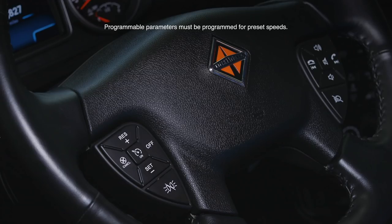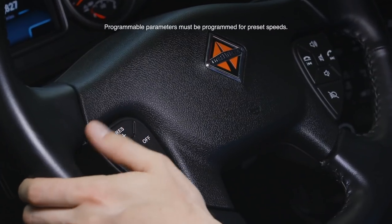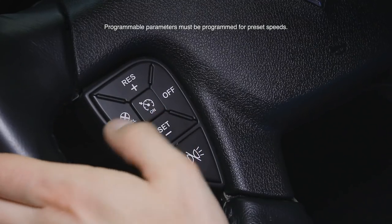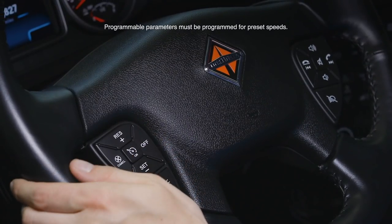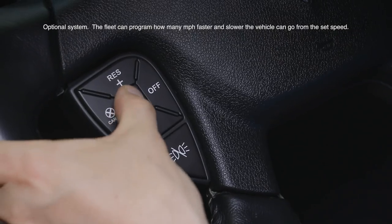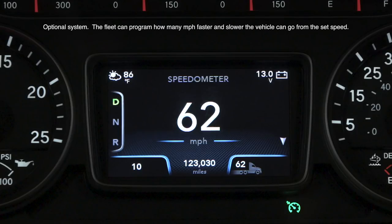Optional programming can allow the engine brake to automatically apply to maintain vehicle speed, regardless of engine brake setting. When the parking brake is set and the transmission is in neutral, press the cruise ON switch. Press RES to ramp up the engine or cycle through the preset speeds. Press SET to ramp down the engine or cycle through the preset speeds. Press OFF to return to normal low idle speed. Predictive cruise control uses an onboard GPS pre-programmed with major roads, then adjusts vehicle speed for optimal fuel economy. Predictive cruise control is operated the same as traditional cruise control. The vehicle will adjust speed above and below your cruise control set speed, up to the maximum allowable deviation programmed by the fleet.